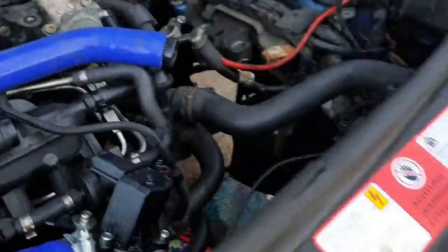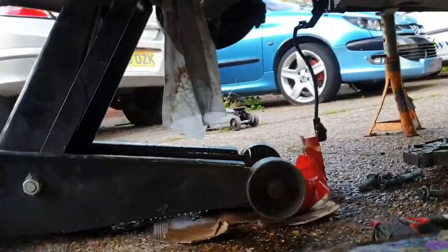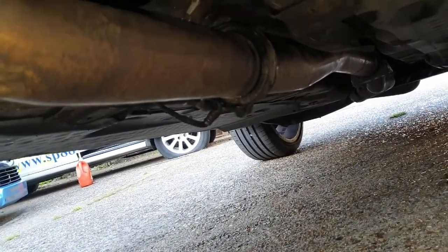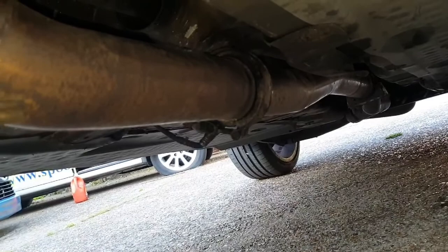Yeah, downpipe. If you look in one of my really old videos, you can see that I had bought the cheap downpipe off eBay. It came with 3" to 2.5" for the standard exhaust system, where I just cut off the 2.5" and bought a 3" stainless steel pipe and had it cut and shut. And the cat came with the Milltek rear system, so happy with that.